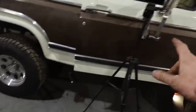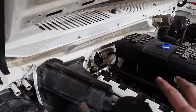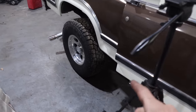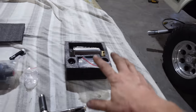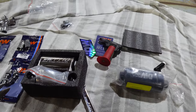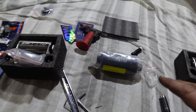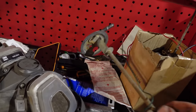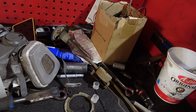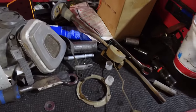I ran the fuel lines nicely down the back of the engine and down the firewall. I'm not going to secure them in that corner yet until I have the exhaust on, but I know where the filter is going to go. I'll give myself a little extra, take the line back off, mount the 5-micron filter because I'm working backwards, and then bring the line up to the tank. The tank's paint should be dry tomorrow so I can mount the tank. I have to install an extra fitting into the fuel pump yet — I had to grab some oxygen and brazing rod — and we can braze that fitting in, then hook up both lines, figure out our ohms for the meter, and we're golden.